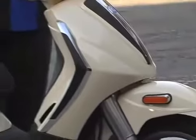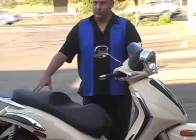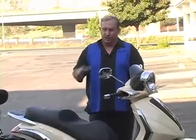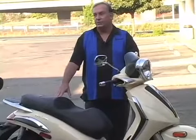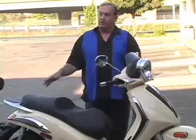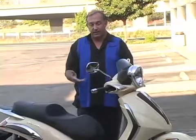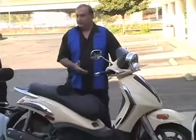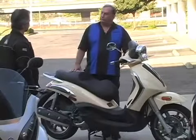The main reason that this scooter is more like a motorcycle is it's got a lot more power than your typical scooter. It also has two brakes on the front. Your best braking is done with the front wheel — we don't notice this in our car when we step on one pedal and brake four wheels, but it's very important on a motorcycle. It has two brakes on the front because it has more weight and more power. If you're zooming down the freeway at 70 miles an hour, you want to be able to stop safely. Large wheels for safety and handling, plus extra braking.